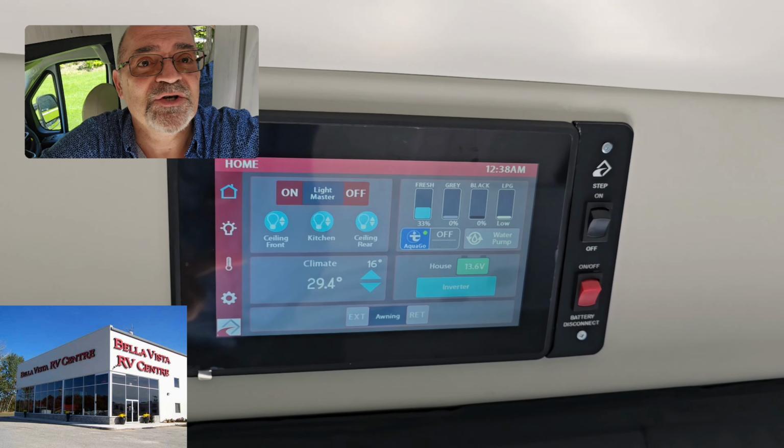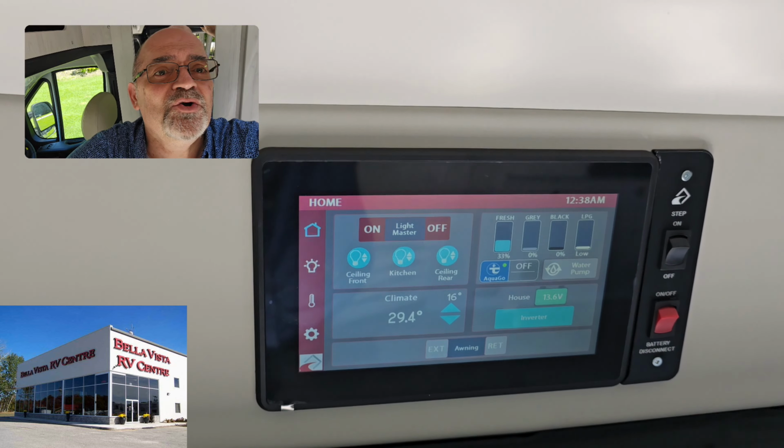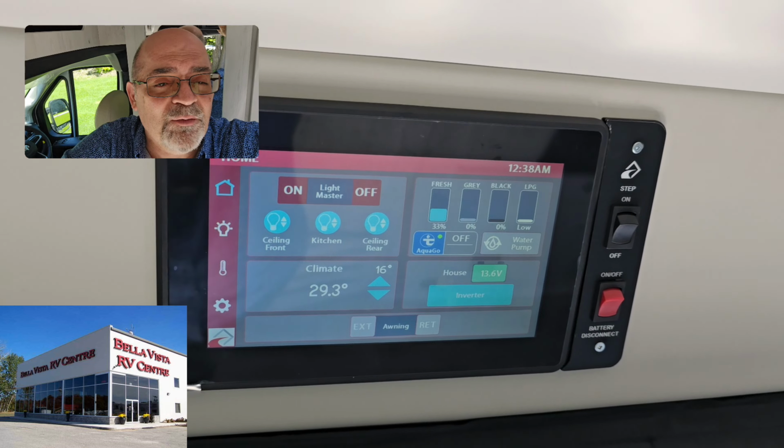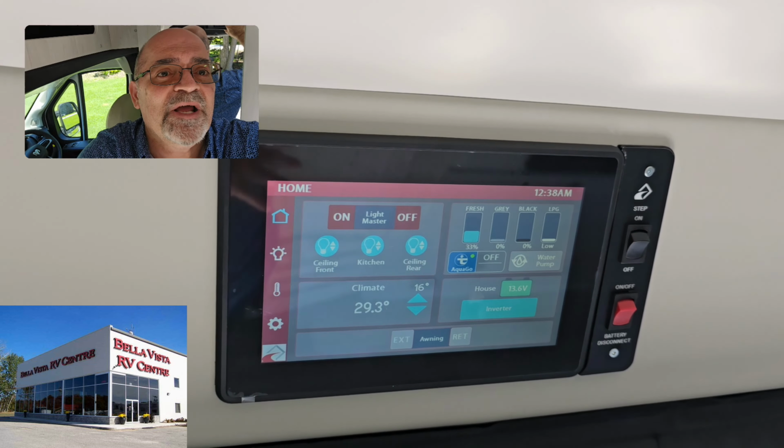It's an interesting question because it's something a lot of people don't know exactly about out in the industry because it's a newer technology. Traditionally, we've had vans or C-classes with side-mounted generators, but you're going to notice more and more units, especially higher quality units, are actually advertising underhood generators. So what they're doing is taking a big battery, putting an inverter on board, where you don't find that on a lot of vans. And that inverter on this coach is a 3,000 watt inverter to power our equipment. So I want to see how long we can run.